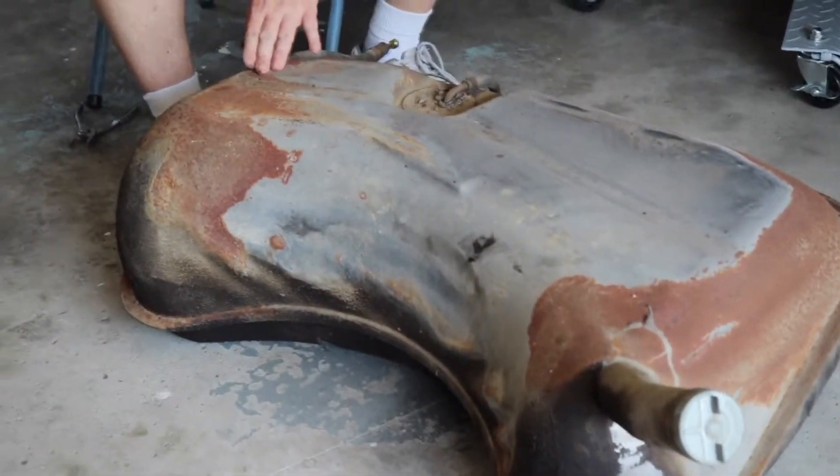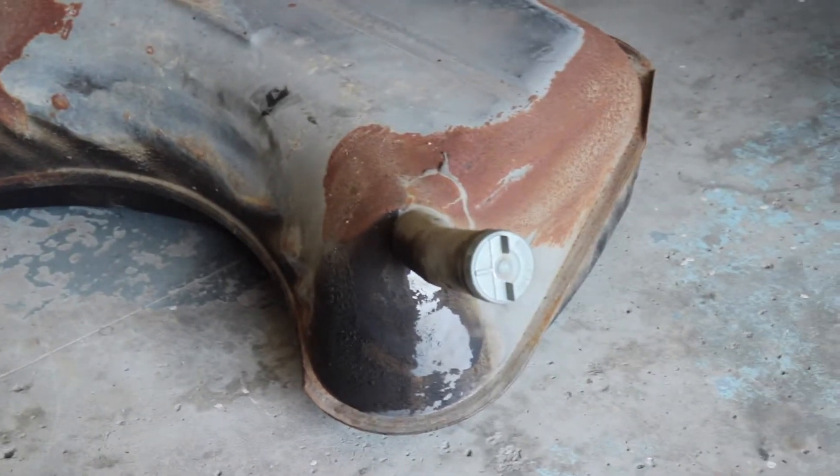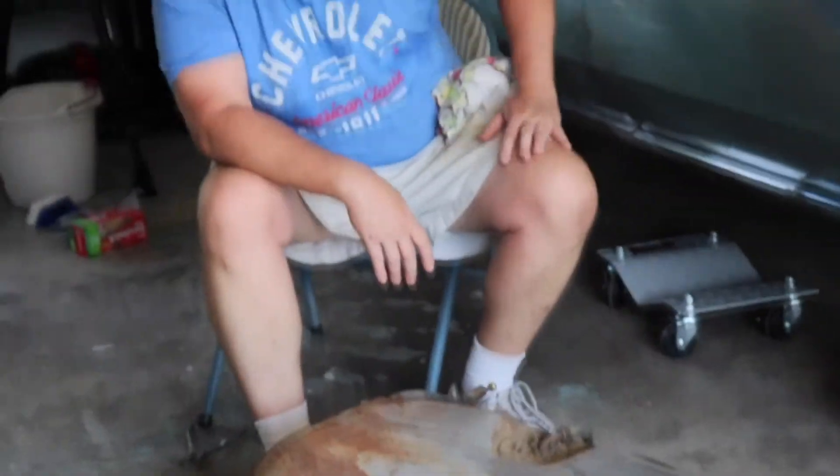Really happy to have this out. It looks good. Give it some love like everything else and then eventually we'll put it back in. We're gonna do the one step underneath the car as well, because although we haven't found any major rust under there, there's surface rust wherever there wasn't rust proofing. It looks like it was originally rust proofed, but it's so old a lot of it's cracked and fallen off. So we're gonna get all that off, treat it where we need to with rust killer, and then re-rust proof it and make it right.